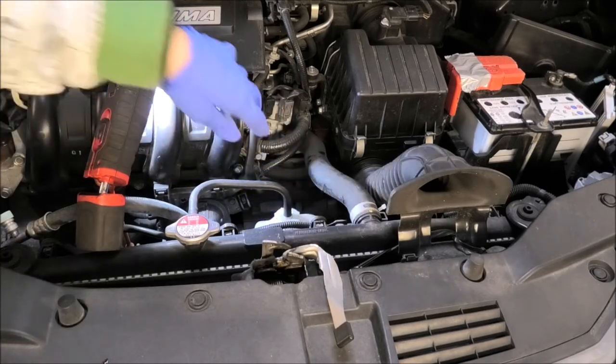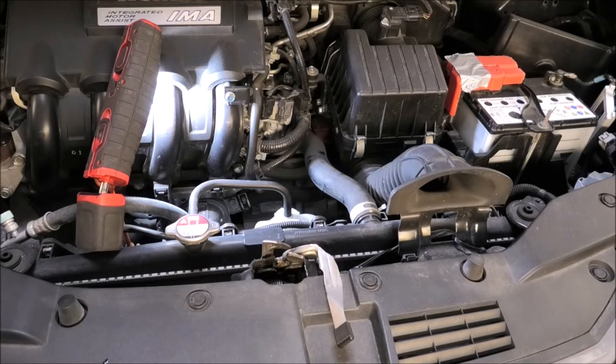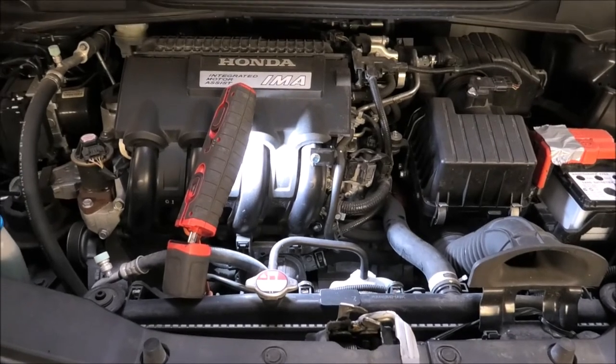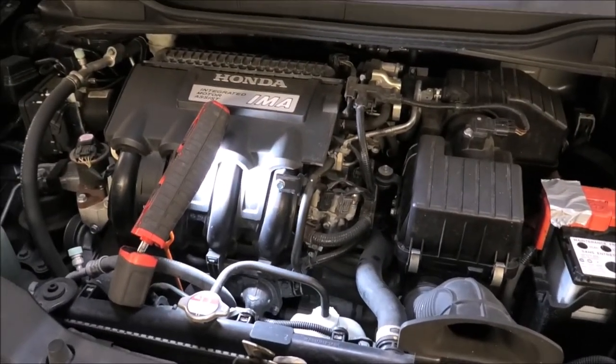And the coolant is also very nice and clean, which is the other thing to check for. If that coolant wasn't clear — if it was dirty, if it was looking brown — then we need to think about changing it. Technically, you should change it every two years according to many manufacturers, though I know many people don't. With time, it collects corrosion from the radiator and other metal pipes and can become a little bit brown. But this is why we need the antifreeze — it protects the engine and everything else from rusting, as opposed to just having water.